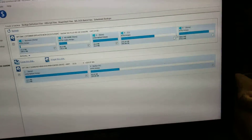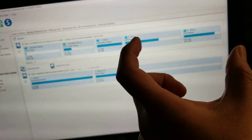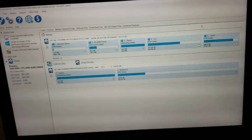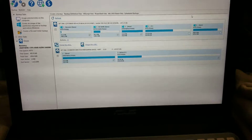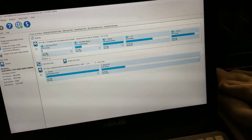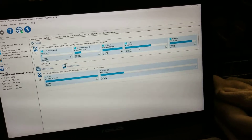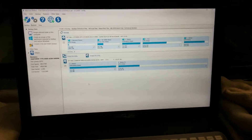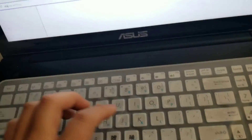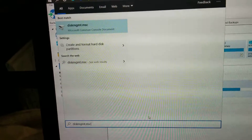If your computer has all these partitions and you want to keep all of them — if you're using a larger hard drive that can fit everything, or a smaller hard drive — you'll need a software to manage the partitions. I use a software called Parted Magic. It basically boots like a Linux environment that has all these utilities to manage hard drive partitions. Basically you'll want to move all the free space so it's unallocated, and then you can move the partitions behind the unallocated memory so that when you check all the partitions, all the extra space won't be trying to clone onto the new drive. After you do that, you can go back into Parted Magic and extend back out the memory into the unallocated memory. If you're upgrading to a larger hard drive, sometimes it doesn't automatically pull the extra empty memory into the main partition. To fix that, go to the Start menu and type disk MGMT.msc and press Enter.